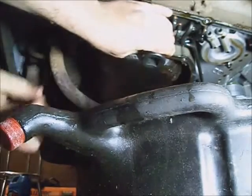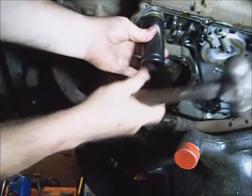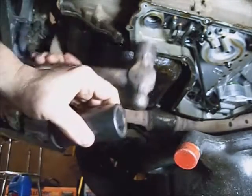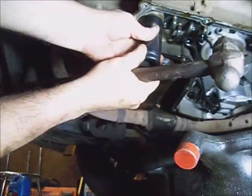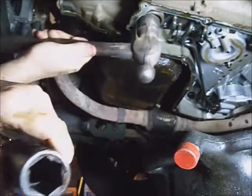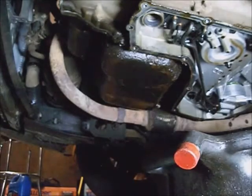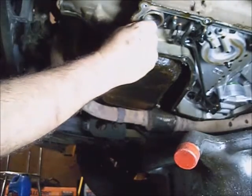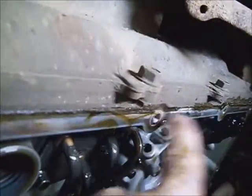Make sure it starts square. You really don't want to hit on one particular place — you'll roll the middle. Verify it's flat all the way around. That looks good. Go ahead and wash all this off, clean this seat off for the new seal, dry it up some. That's why you let it drain for a while.